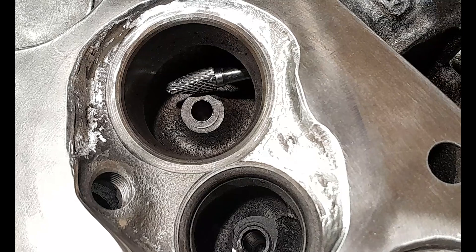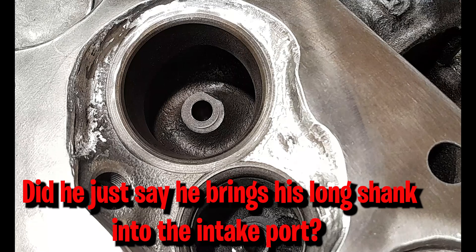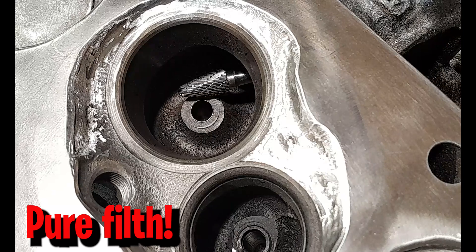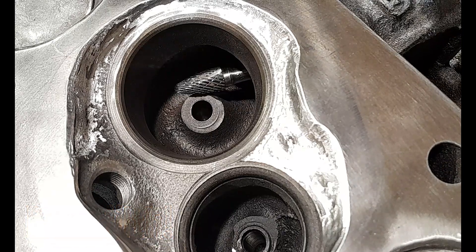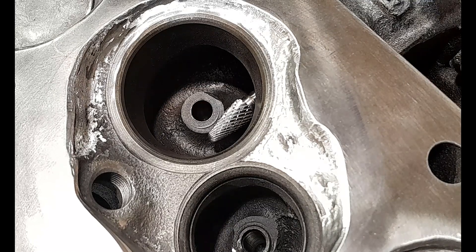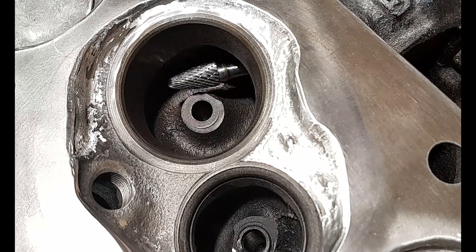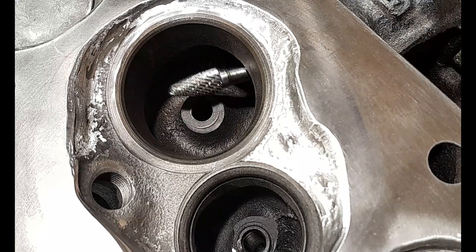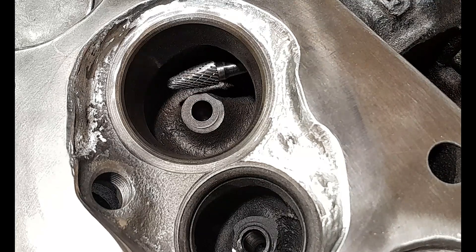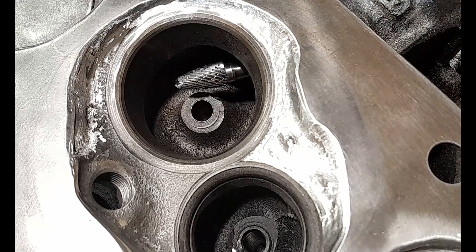So this is what I'm doing. When you bring your long shank tapered die grinder into the intake port, the natural angle of the intake port puts you in like this. What we're going to do is cut this in a V — cut it down this way, then swap and cut it down the other way, essentially shaping this into the bow of a boat. Once the majority has been cut down with the carbide burr, I'll get my rotary tool with the flex shaft and mini stones and smooth it all with the stones. All right, let's thin this boss down.